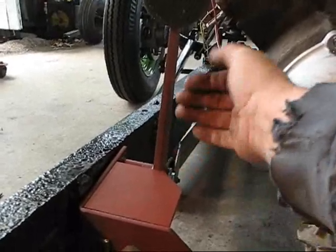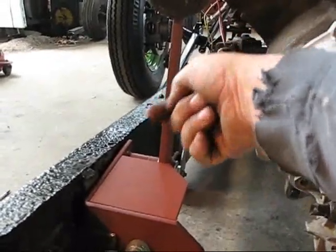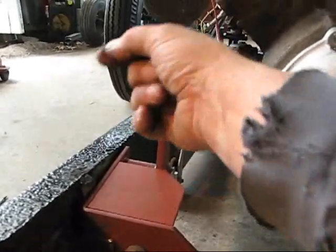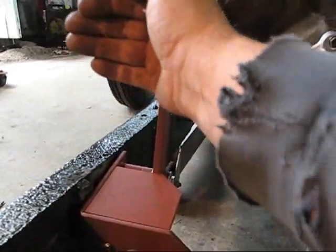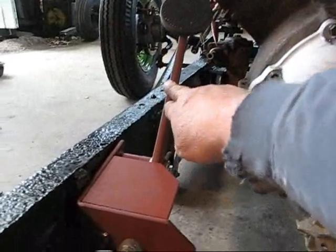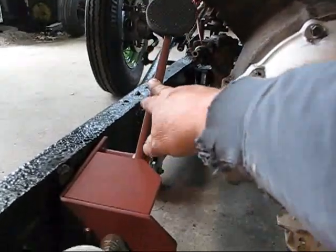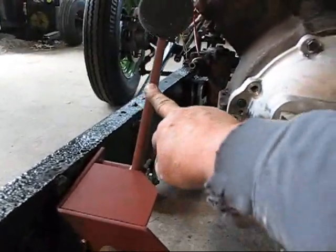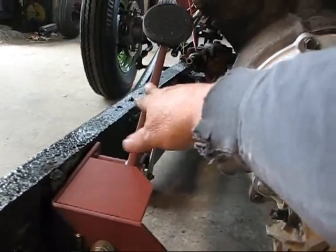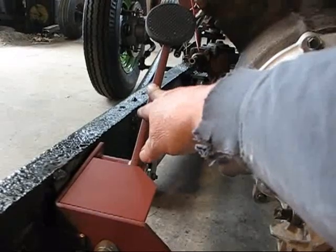On the other hand, if it needs to come forward some, I can kind of put a curl in this or extend it out this way and set my pedal in here a little bit more so that my box would sit here but a pedal would be a little bit further out, so I'd have plenty of room. If it does need that much, then basically I would need to cut this and move it forward a little bit because that actually would be getting into the firewall.